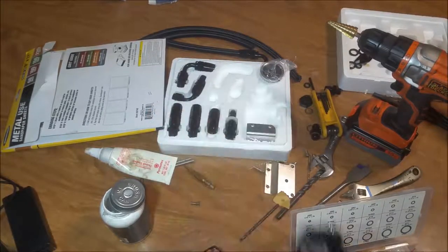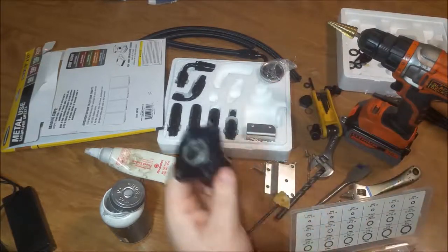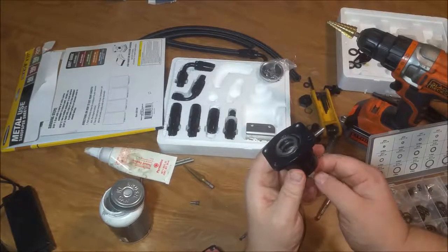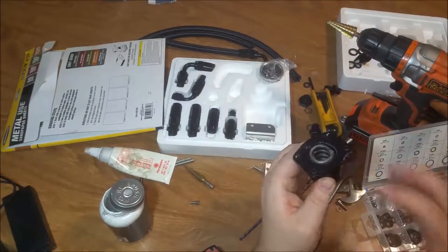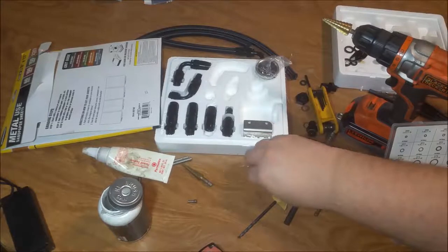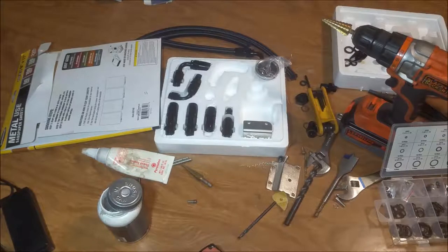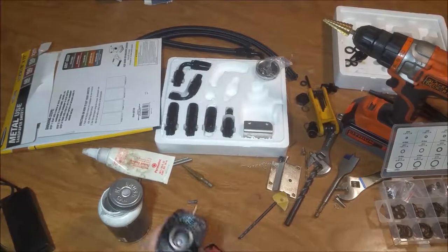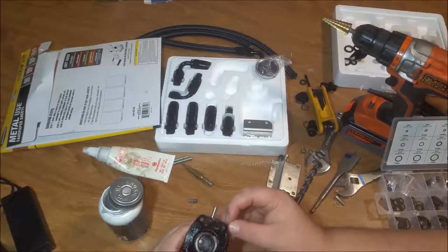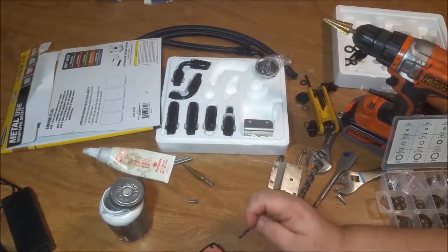So, what you want to do, probably here, is get your spring where it protrudes just a hair. Well, I guess you wouldn't even need to do that. Just go ahead and back it off. Just flush. And then go ahead and get your screws ready, because your screws are going to be your centering factor, like how you center that seal. The screws and the actual seals, the valve in there, the needle and seat inside there, that's going to be how it's going to seal.